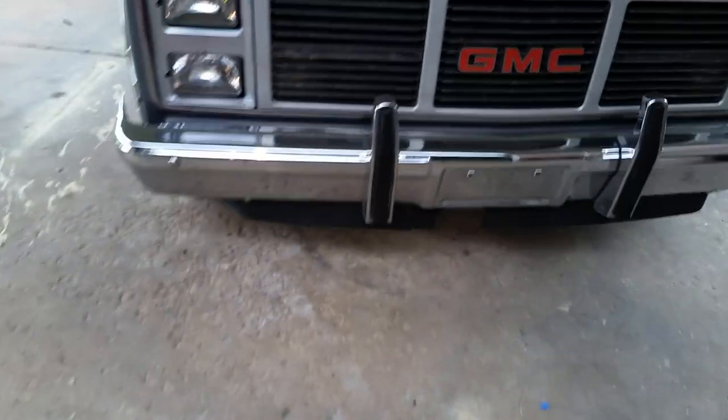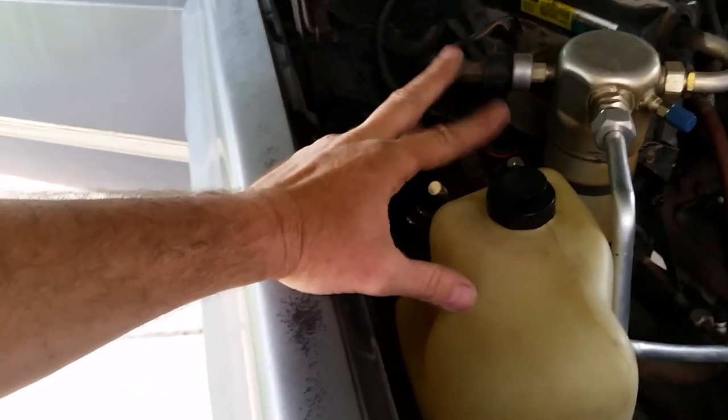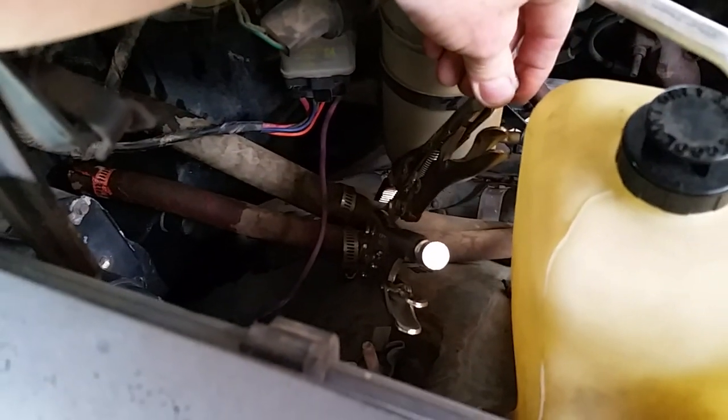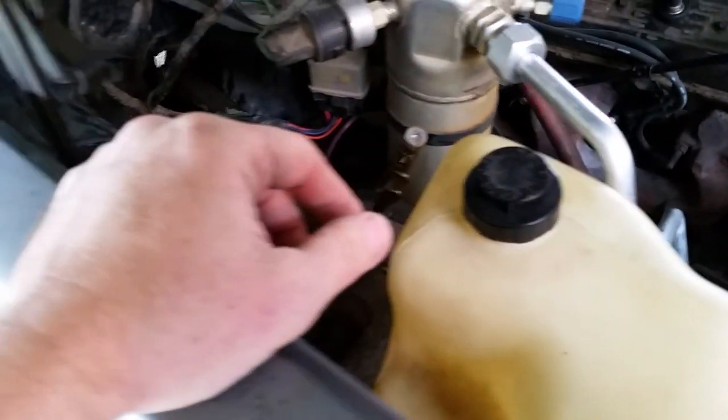Anyway, guys, that is pretty much a heater core on my '87 GMC Sierra Classic. I know these trucks were '73 to '87, but I just don't know what all years that box is. And mine is with AC. If it was just a heater truck, non-AC, it's definitely going to be different. I also clamped my hoses with vise grips before I took them loose, to keep from losing a lot of antifreeze out on the ground.